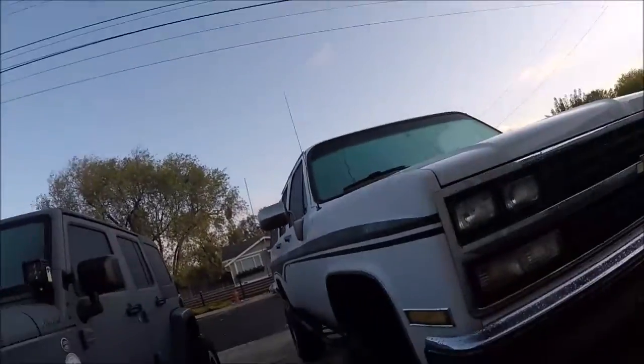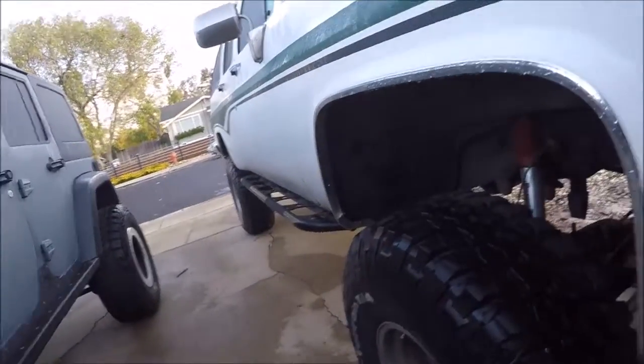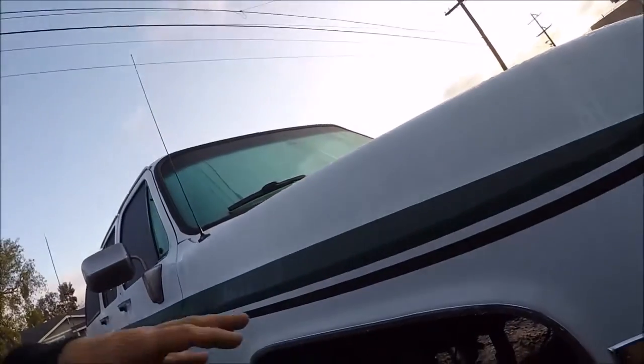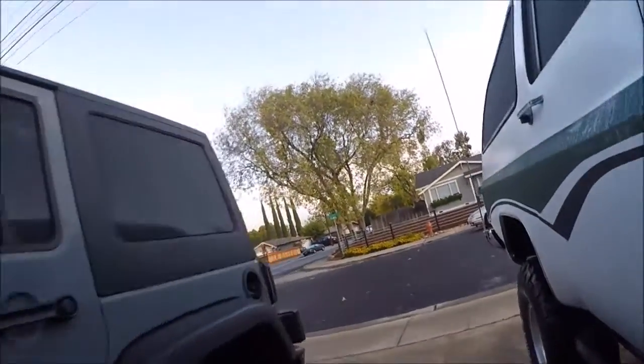So, I went and balanced the wheels the other day and found out the wheel bearings were bad, so I replaced both front wheel bearings, both sides, inner outers. Found out one of the hubs was not put together right, so fixed that. Yesterday I built tailpipes